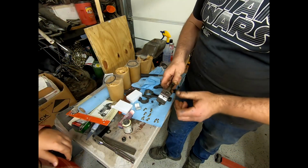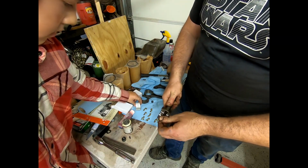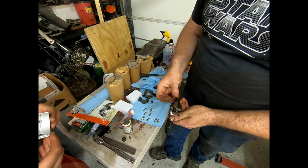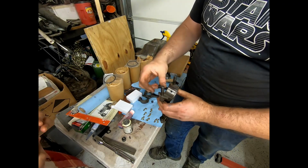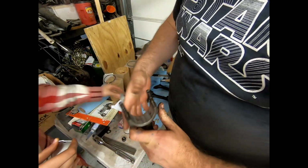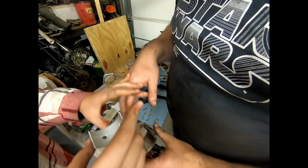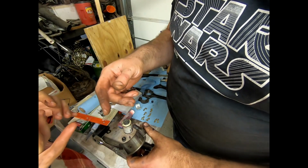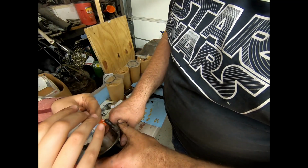All right, so we're going to push these bolts back up where they go. Rod bolts are in general supposed to be slightly tight, like this. Okay, now I want you to take one of those bearings. Check the back, make sure it's clean. Never assume it's clean. Okay, good. Now go ahead and roll it in. You know how to do it.